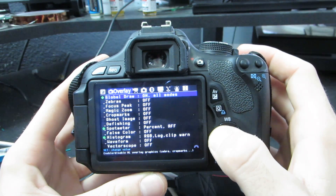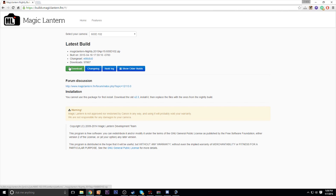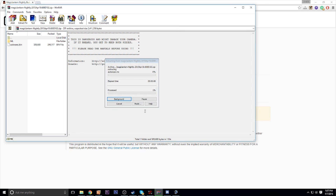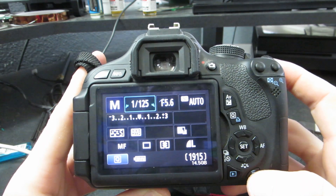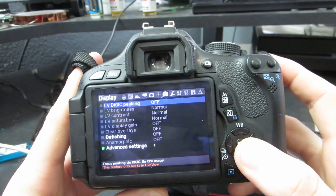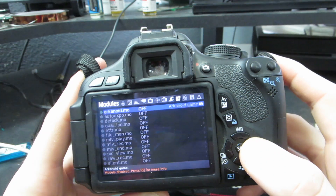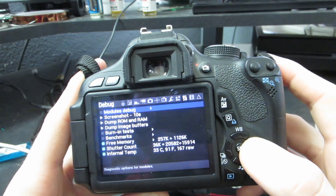I will show you how to install the latest nightly build if you want. To do so, take your SD card back out and pop it back into your computer. On the Magic Lantern page, go ahead and click download under the latest build. Warning — there is a chance that this could potentially damage your camera. They are tested, but the latest nightly builds, because they have additional features and new updates, there's always a chance that they can be glitching. All you're going to do is extract the files in that nightly build to your SD card, and it will replace the matching files. When it says do you want to overwrite files, just click yes to replace the old files. Once done, pop it back into your Canon camera and it is already updated — you don't actually have to do anything. It looks a lot different than the core Magic Lantern — it's got a bunch of different tabs with a crazy amount of additional features. If you browse over to one of the tabs on the very bottom, it will show you that you are indeed on the version of the nightly build that you just installed.